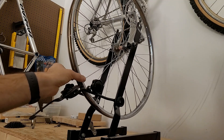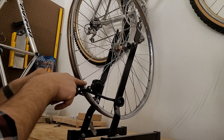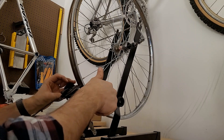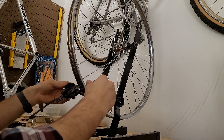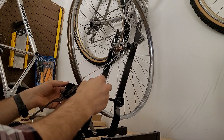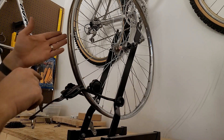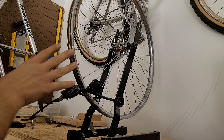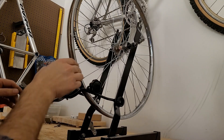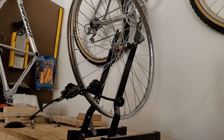There's still some left-to-right wobble. Now that this is dished, I want to keep this rim totally centered, so I'm going to count threads and narrow these in to make sure it's not going side to side too much, and I can just tighten accordingly the rest of the way. Once the non-drive side nipples are tensioned fairly evenly and I do fine-tune adjustments, it's maybe a quarter turn at most per nipple to get it tensioned and perfectly aligned.